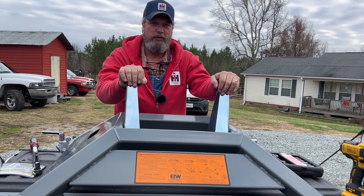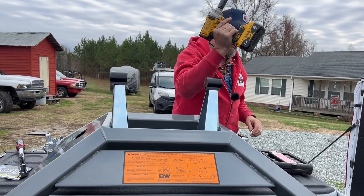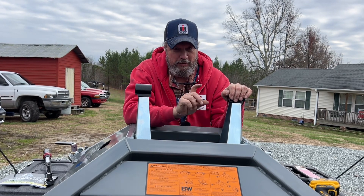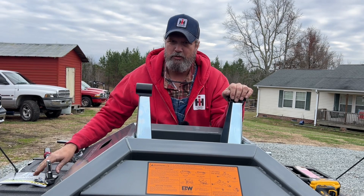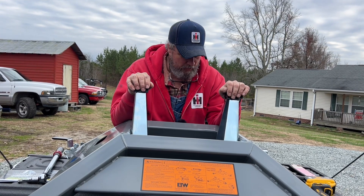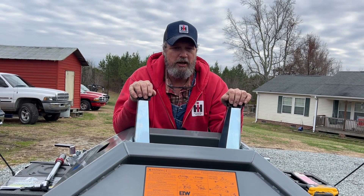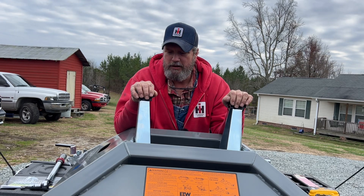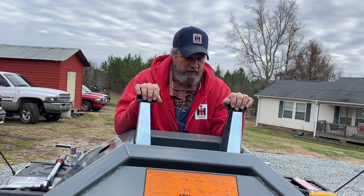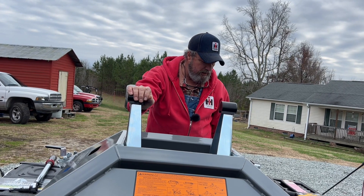We got these installed. I didn't see the torque on these at first, but it actually turned out to be 110 foot pounds. And believe it or not, it wanted to go just a little bit more when I did torque it with the torque wrench. Like I said, I don't have a trailer. There was two inches behind the axle — I could go two inches in front of the axle. Since this is a long bed, I'm sitting it up over the axle. You could go from 17 inches high to 19 inches high, and I'm going to go 18. So we'll hit it in the middle there.